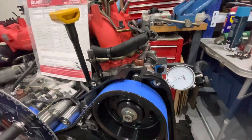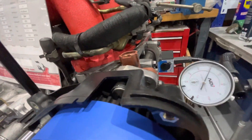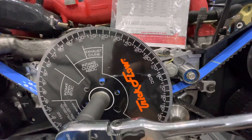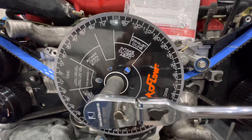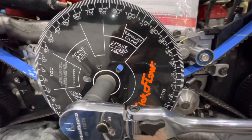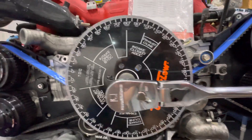Keep on cranking. What we want to see is one millimeter before the valve closes now. I can see that if I come up on the wheel, I'm just about to see bottom dead center. And I'm going to keep on cranking until I see 43. It's a bit hard with one hand. You can see here I'm on 43. Keep on going. That's on 43.